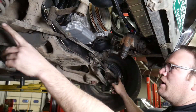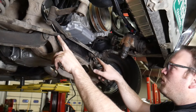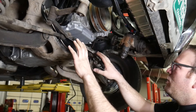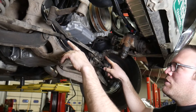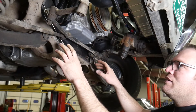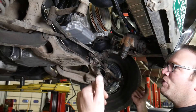We're retaining the tie rods. I'm going to chisel off some of this grease, get the cotter pins out, get the nuts off, and separate these tie rods from the center link. All this stuff, even though it looks really old, doesn't have any play in it — or at least nothing we can tell because everything else is kind of loose. The steering gear is loose, this joint right here is loose, the idler arm is loose. When we get all the new stuff in, we can check for sure. I'll clean up some of this stuff and spray some penetrating oil on here.